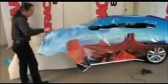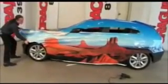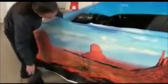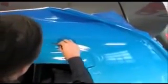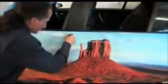Now, the protective paper is pulled off the last third of the vinyl width, and the vinyl is aligned and firmly placed on the vehicle. The vinyl is preheated in large sections and, beginning at the straight edge, smoothed out evenly with the squeegee from the centre outwards. Only after the vinyl has cooled down to room temperature may unwanted parts of the vinyl be cut off. Pointed and sharp blades should be used to do this. Never cut right on the paintwork.